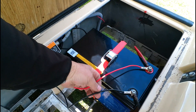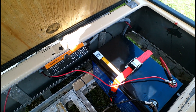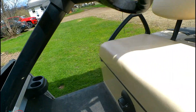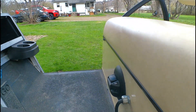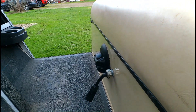This is the charging connection that came with the brand new charger. I was trying to come up with a way to keep from having to have the seat up or take the seat off. I didn't want the wires hanging out the edge where they could get pinched and wear through. So what I ended up doing was I drilled a hole and put a cord grip, put the end in here. With time it's going to sag down and be pretty much out of the way of your feet. This is going to make it so much easier just to hook the charger in and charge the battery.